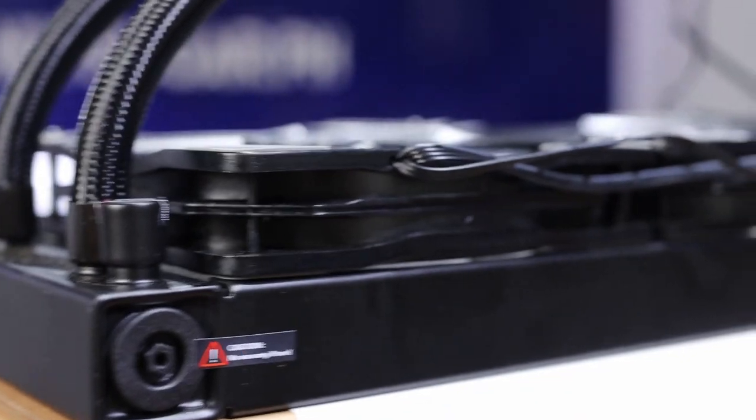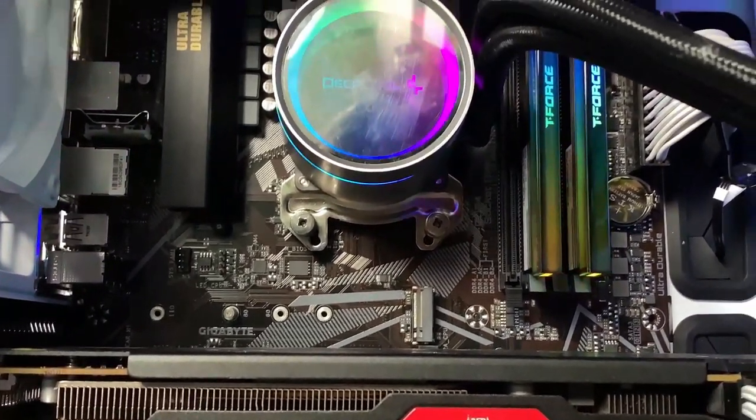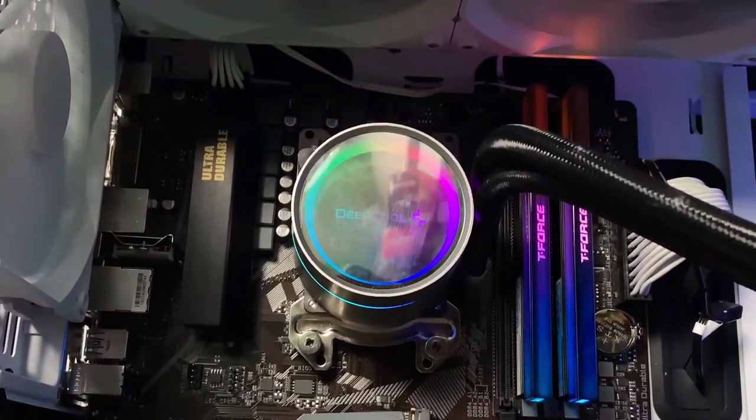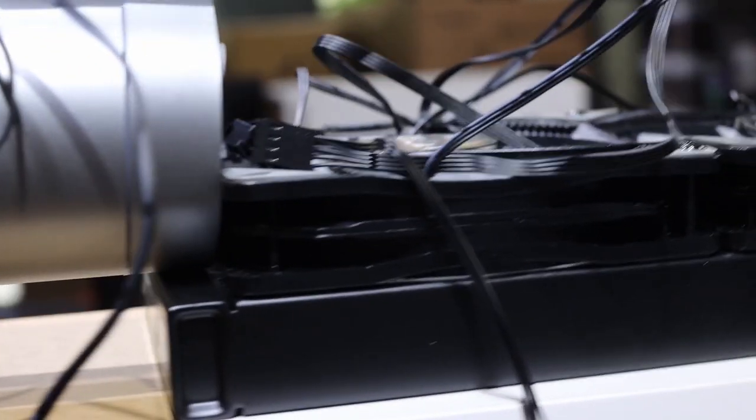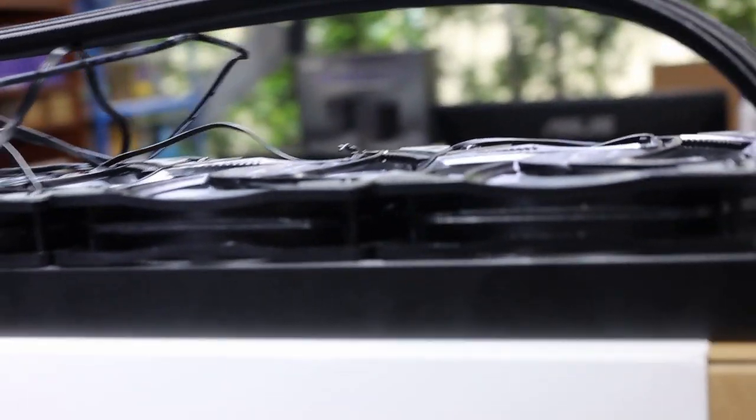And I bring this up because usually most customers just go for a 240mm RAD. It's easier to fit in most cases, it's cheaper than the 360mm. And generally, we usually recommend that, yeah, the 240mm is fine. But after seeing these numbers, at least we can now tell the customer that there is a significant performance gain if you do go for the larger radiator, and specifically the Castle 360X.